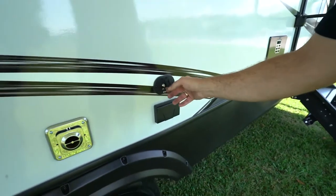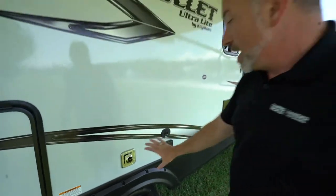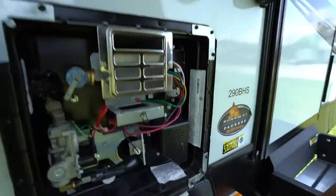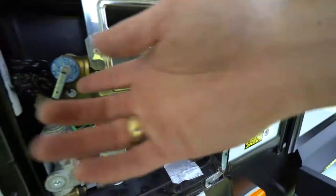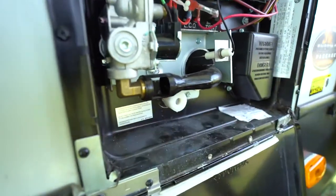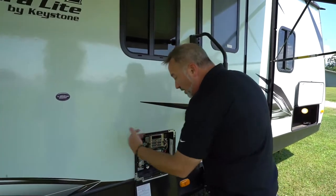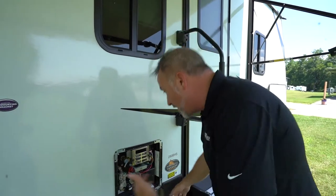For your furnace, you'll see the back plate right here. This is the Dometic 30,000 BTU furnace, which comes standard in all of the Keystone Bullet Ultralights. This is the vent, so watch out for that — try not to put any chairs here if you're running the heater, as that's hot air and it could cause issues. You're going to have either the Dometic or the Suburban water heater. The control panel is exposed on this Dometic, and when these break they have to be replaced. Keep some pipe cleaners handy — especially after storage, get in there and get all the cobwebs out, because mercaptan attracts bugs. Spiders will cause nests and all of a sudden you're getting flashback. If you don't want to burn out the element, keep that clean. Also, if you notice streaks or debris on top of the hot water heater, that means there's debris being blown up or you're getting flashback — just clean out that tube.